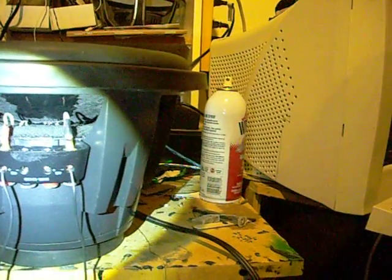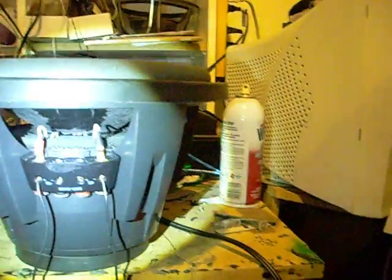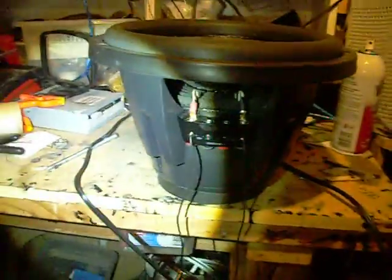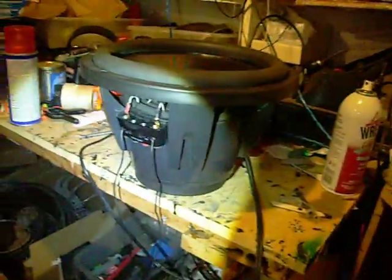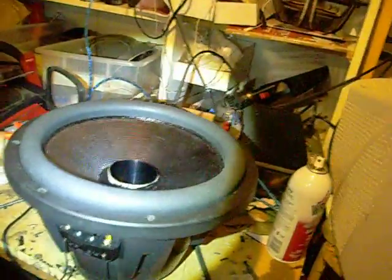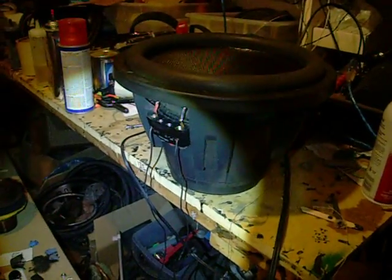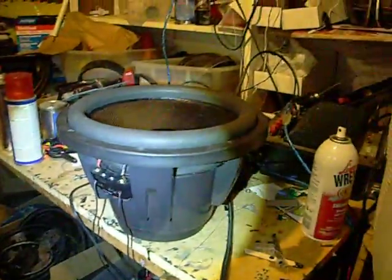Single, stiff. It's a dual 1 ohm wire to 2 ohms. So I've got about a 300 watt amp on it right now. It's free air. No dome. And I've got my cell phone here playing satellite radio. It's just a free air test so don't get excited.